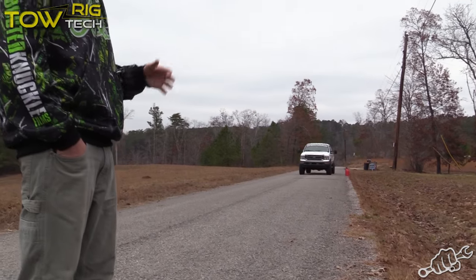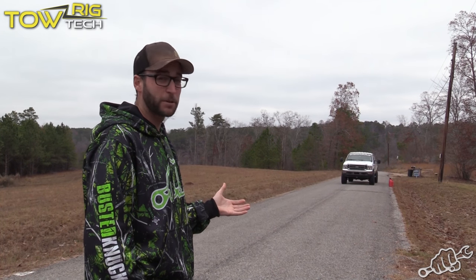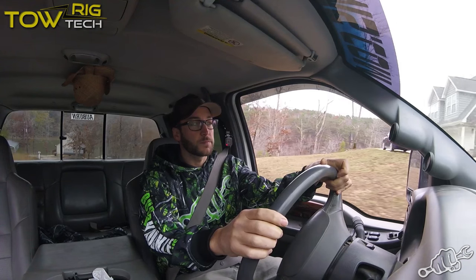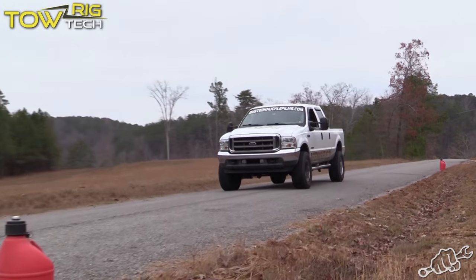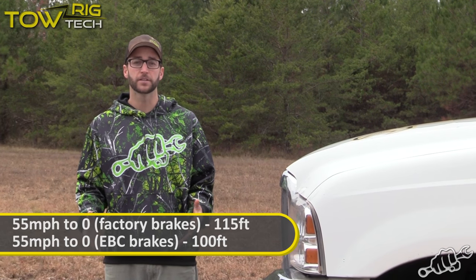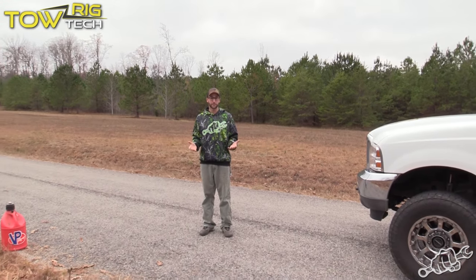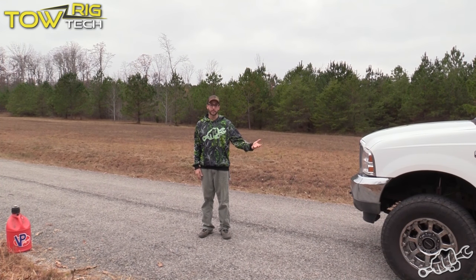At the beginning of this video, we did a 55 mile an hour to zero brake stop with the factory setup on the truck and it went 115 feet. Now that we put the EBC brakes on, we're hoping it's going to do better than that. We did a few tests with the EBC setup on the truck and kept getting the same result — stopping at about 100 feet each time. That's 15 feet shorter than the stock brake setup. While that might not sound like a lot, that's a 13% overall brake performance increase. At 55 mile an hour normal highway driving, you could easily fit a car in that space — so it could be the difference between stopping or rear-ending the car in front of you in an emergency situation.